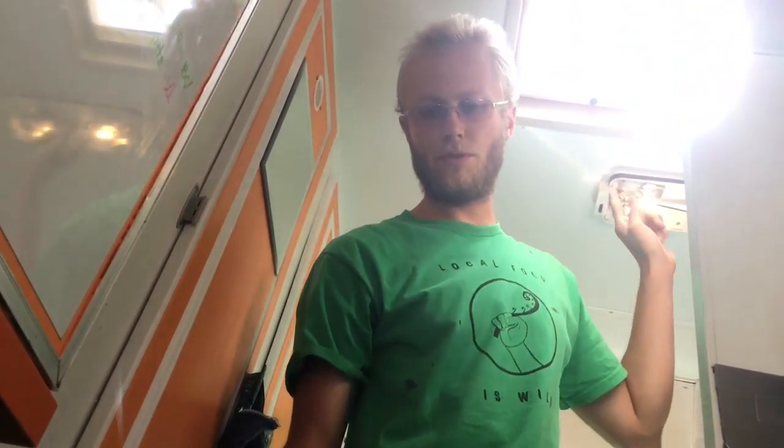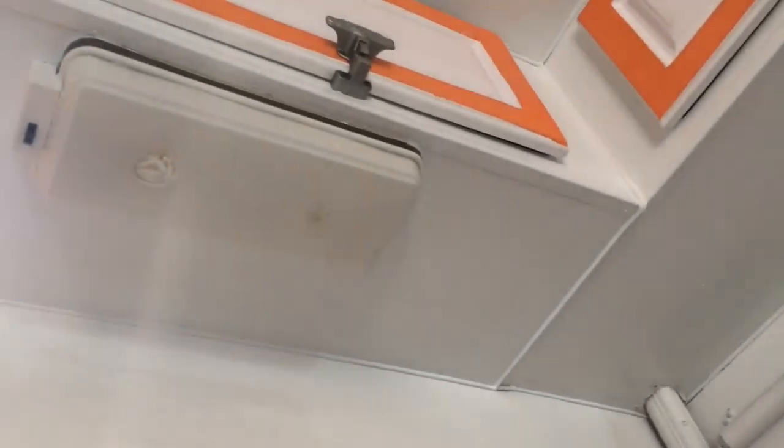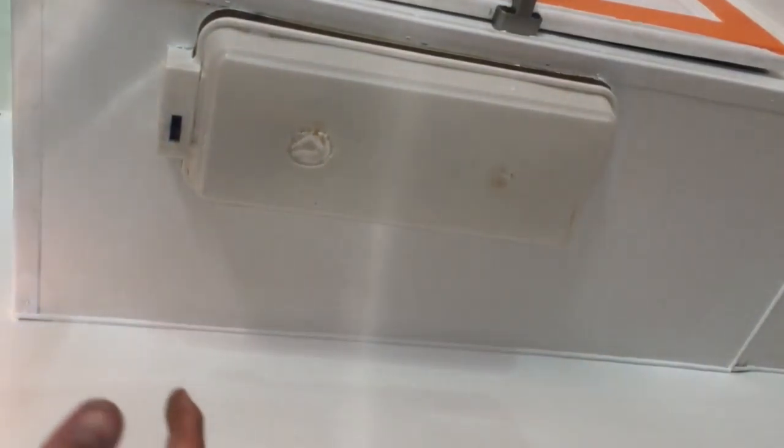When we're not using it for important things like the wall plugins, we turn it back to DC to save power. You can see the difference in the lights — DC versus AC. The problem is in our kitchen the previous owners put the wrong light bulbs, and when they plugged into the campsite it gave the light bulbs a lot more juice than the camper was designed for, so they started melting out the bottoms of the lights. Make sure you get the right light bulbs. We try not to turn these on unless we're on DC — if the inverter is on, we shut all the lights off.